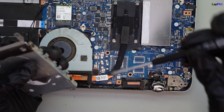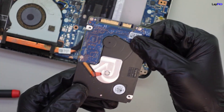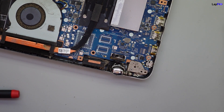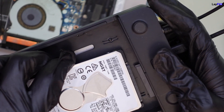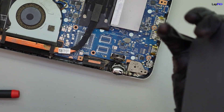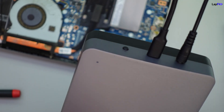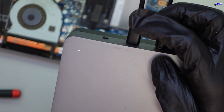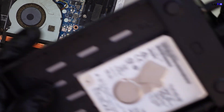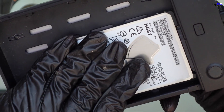Let's focus on the main problem here. Let's first see if the hard drive is healthy. So we took out the hard drive — this is an HGST hard drive. I'm going to plug it into my little USB-C adapter because we just want to check the status of it first, see if it does anything differently or makes any noises. So that does sound like there was actually a problem with the drive. It sounds like the head is actually stuck — that's why it's not spinning. It's not doing anything because it can't.